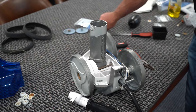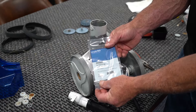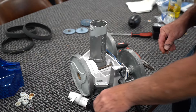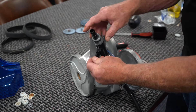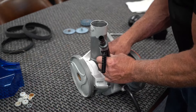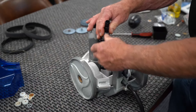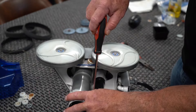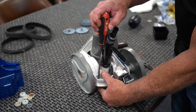As I mentioned, it's very important to replace the O-ring, and that part number is 9-100-5132. Go ahead and put that on the bottom of your supply tube. Now you're going to have to put that in — and this is why you don't tighten the screws up, so you can actually fit that tube in there. Tighten them up — you don't have to make them killer tight — and now we're going to go ahead and tighten down the body.